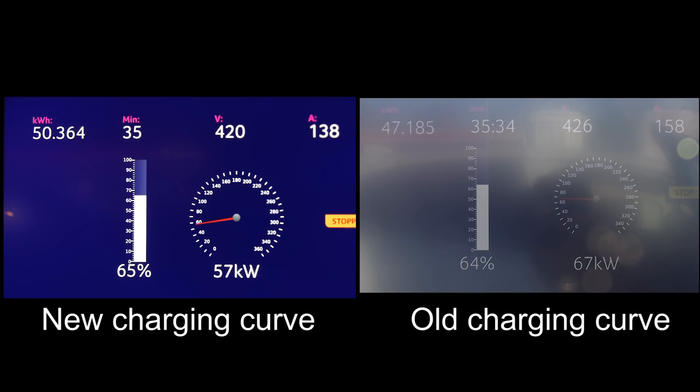It's not the first time I've seen this — I've seen Tesla do the exact same thing. With the 100-pack and the 75-pack, people were reporting 150 kilowatt peak, and the 75-pack would suddenly peak at 135 kilowatt when they could only get 100-110 before. But when I actually recorded the whole charging session, it turns out Tesla did give you higher peak power, but if you want to charge to 70%, it was actually slower than before. Now we are only getting 50 kilowatts while the old curve had 60 kilowatts.